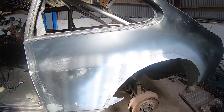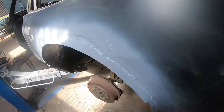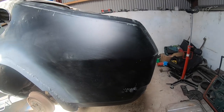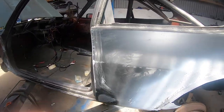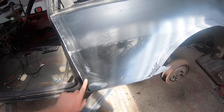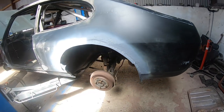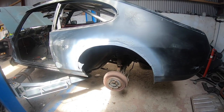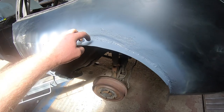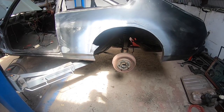Welcome back to episode 20 — a good round number to be fitting the rear X-Pack kit. I have primed the bare steel where I fitted the tub and I'm going ahead with a coat of paint shortly. Speaking to a body shop, they recommended I key the paint all the way around where the edges are touching and where the panel bond is going to go. They didn't like the idea of putting panel bond on bare steel, so I've keyed it back. There's a good thick coat of paint on the car and I want to get this area treated and painted.